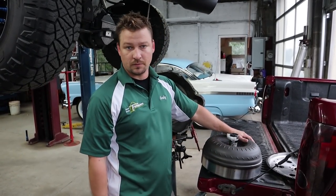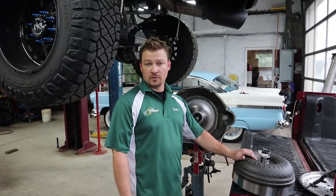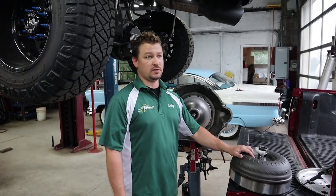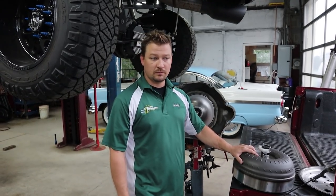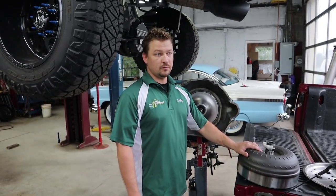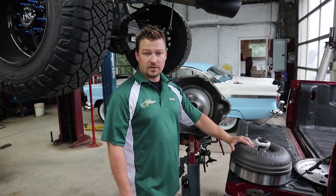If you're dealing with any sort of performance upgrades, you're going to want to go this direction. The converter lockup in these diesels is very active — it's coming on as early as 20 miles an hour under the right load conditions and it's on in almost every single gear. So when you're pulling away, hauling something, or doing a burnout, this thing is doing a lot of work. Besides the drum we put in, this converter is number two on the list. It's not cheap, but when you're this far into it, you don't want to cut corners.